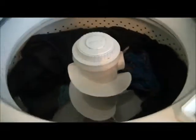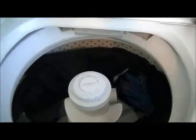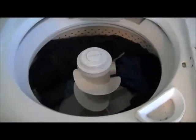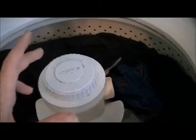Once the water's emptied out and the tub is empty, the air pressure decreases. There is a neutral drain pack — they call it neutral because it doesn't do anything, it just drains. The neutral drain pack will engage the transmission and prevent the clutch drum from turning while it's draining.